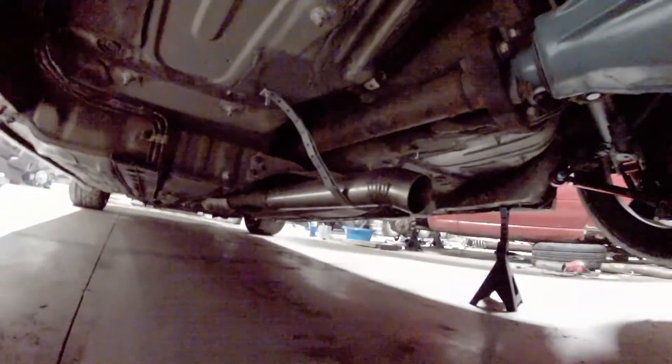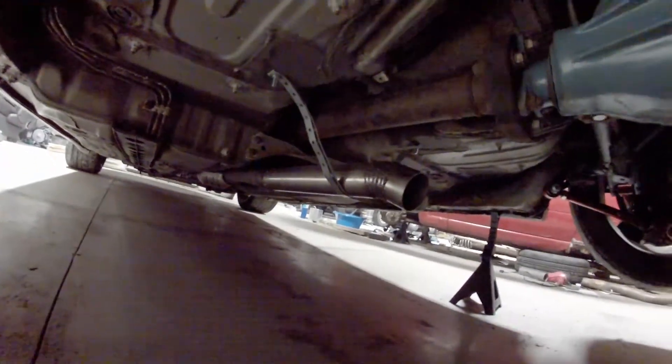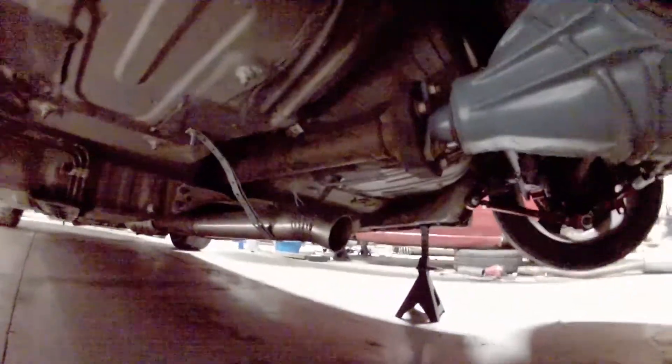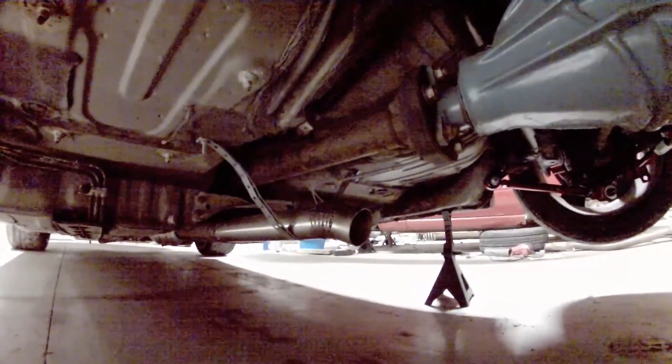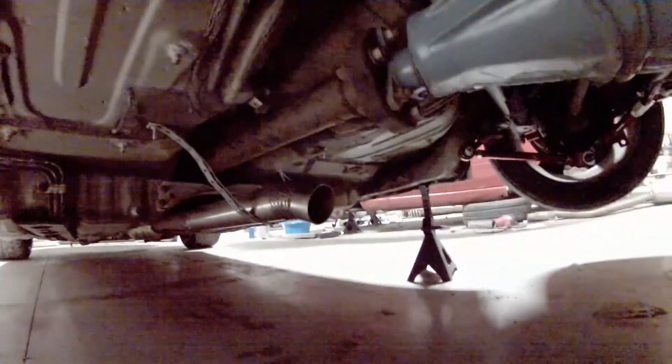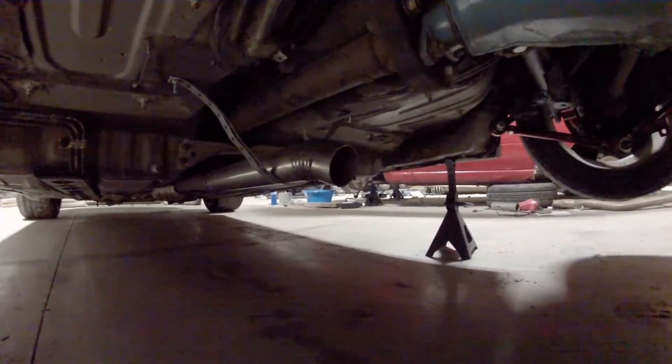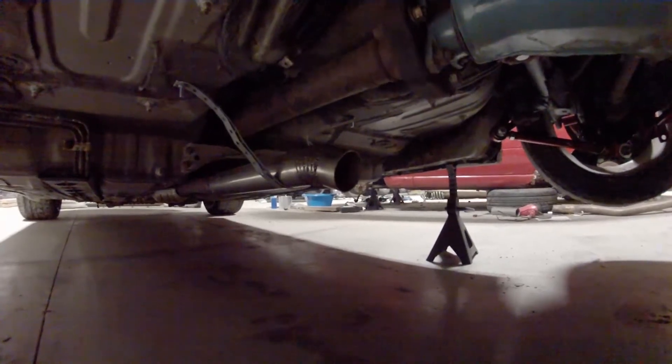I took the car for a test drive and it felt a little too tight, so I took them off and I'm going to give it a shot without them. For exhaust, because I'm a broke ass bitch and can't afford mufflers, I went with just a straight pipe with a turndown that Ronan made for me. For hangers, I just drilled through the floors and used a nut and bolt with hanger strapping to hold the exhaust up. It works pretty well — I haven't had any issues yet. One downside is it kind of rattles a lot inside the car, but it's a drift car and I'm sure I'll get used to it.